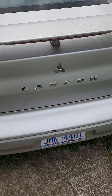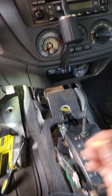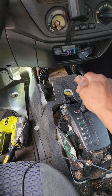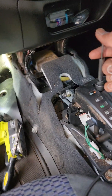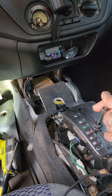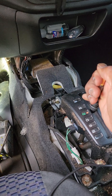This is for all the Mitsubishi Lancer owners out there. I get into my run-around car and the gear shift - I took all of this off already so this is a little bit ahead of time - but the gear shift is locked because the ignition is turned off. But once you turn it on and mash the gear shift, you can see the mechanics of it. I can pull it down, but once you're in gear it won't go in gear - it just moves up and down. That let me know either something is missing or something has come loose.